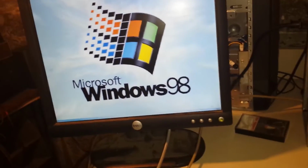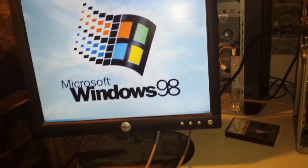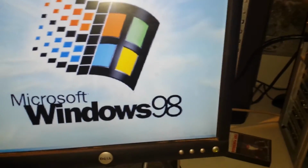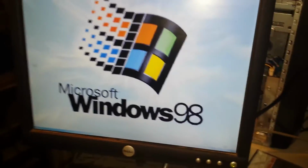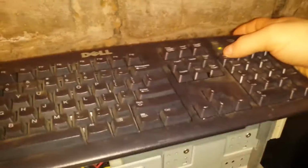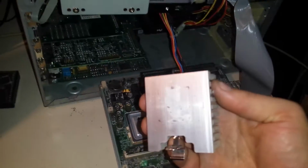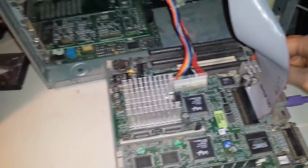You know, something is wrong with this board because it is locking up. And this time I didn't even touch it. I mean, my hands were here on the camera. Yeah, the caps lock light won't shut off, or number lock light won't shut off, the caps lock won't come on. But this thing is pretty warm. I'm thinking maybe because when I got it, there was no heat sink grease on. I'm thinking maybe it's just overheating. So I'll let it cool down. I'll wait for another day to really mess with it.